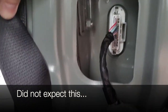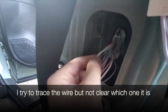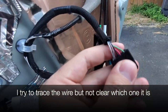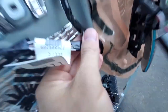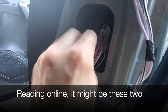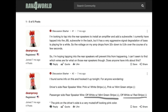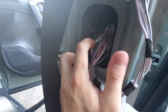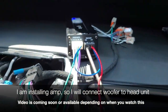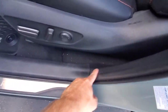I didn't expect to see pins used to connect the door wiring to the vehicle wiring — this changes the installation process for me. I tried to trace the wire to find which one would be the speaker, but didn't have much luck. After reading online in the RAV4World forums, it turns out these two wires here are used to send signal to the speakers. Because in my build I'm going to install an amplifier, I'm not going to connect into the door speakers — my subwoofer will connect directly to the lines coming out of the head unit. Make sure you subscribe so you can see that video coming up.